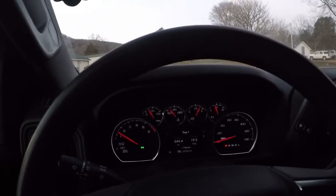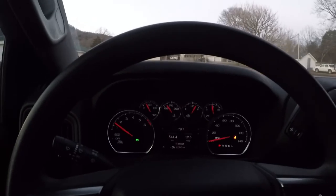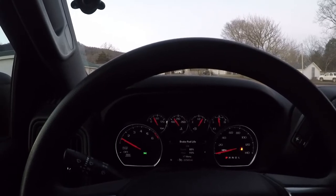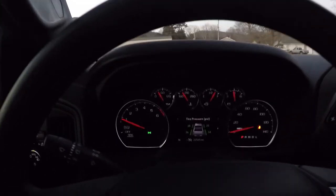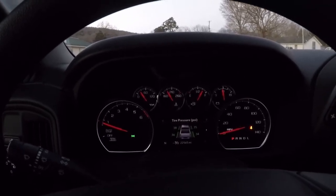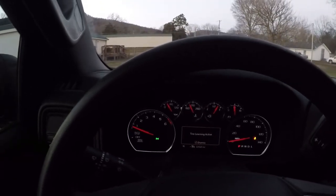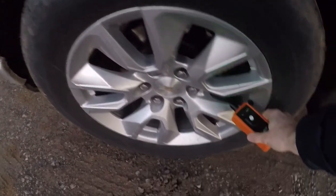Get the truck turned on, steering wheel straightened out, air conditioner cut off. What we have to do is get it over to the tire pressure gauge menu on this truck. If I hold my button down you should enter 'Tire Learning Active.' So now we have to start at the driver's front tire. Coming out, pushing the button - hopefully this will work.